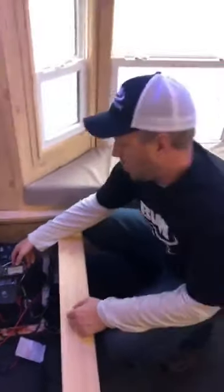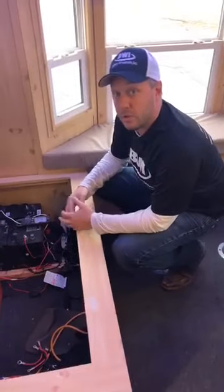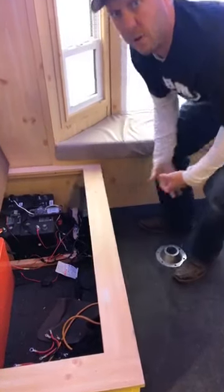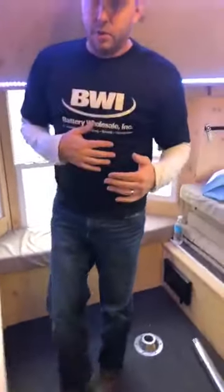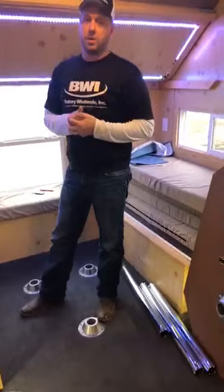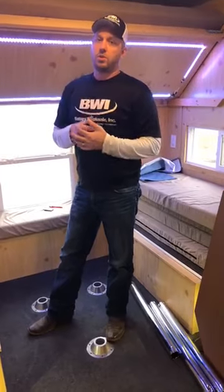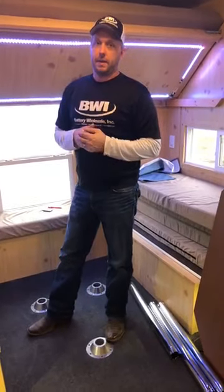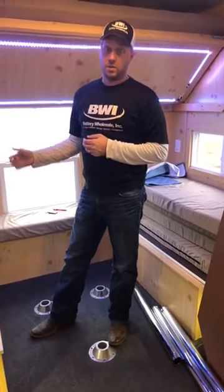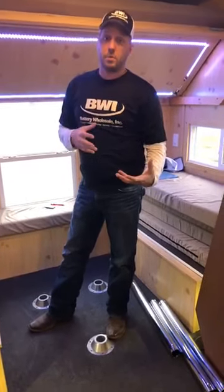You have to take a look at what you're actually putting back into the battery to restore it. Most guys, when they leave on the weekends, aren't letting their generators run all night long, so they may be at negative voltage. When you get home, I recommend big time, plug it in. I know that charger is going to kick on and want to kick more amps back into those batteries. The worst thing you can do is store a battery in a discharged state. It'll kill the battery. If you have wet cells in there and it's really discharged, it will freeze. But a fully charged battery is acid for the most part and won't freeze.